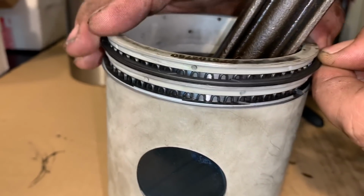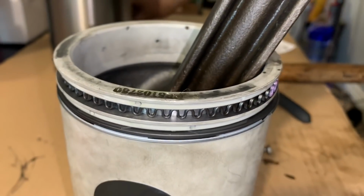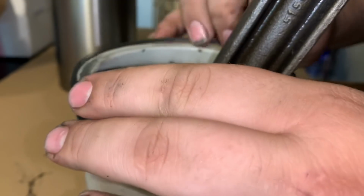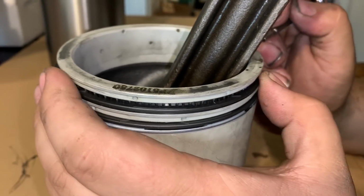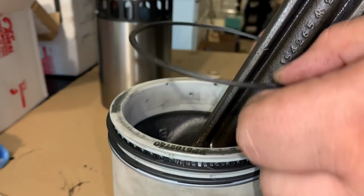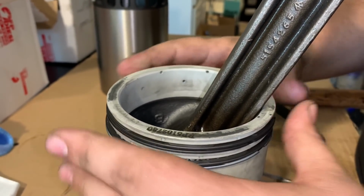Two of them go on each channel. And they're very fragile. If you're ever going to break something, that's what's going to break. Make sure that the spring hasn't jumped itself, by which I mean overlapping, because one side can go over the other end, and then it'll be too fat when you go to squeeze it together, and that's how they break. And a lot of guys don't know that they break them. If it's hard to load in the liner, that usually means you broke it, but they're too lazy to pull it back out and check it and make sure they didn't break it.